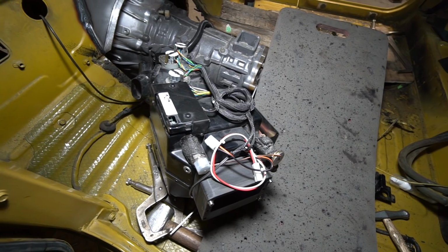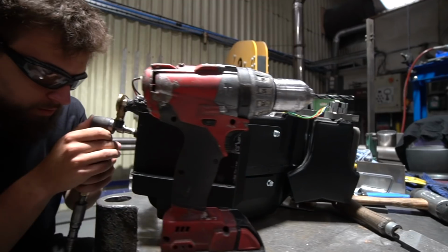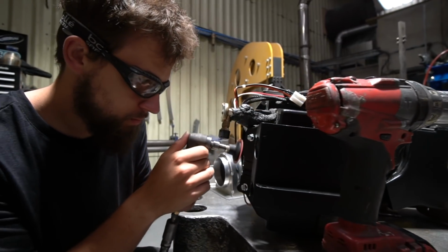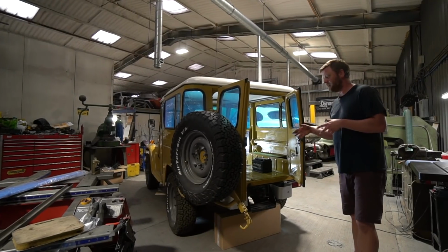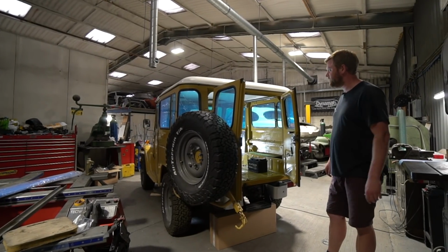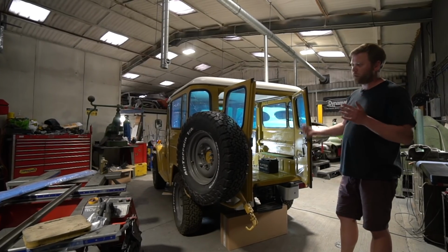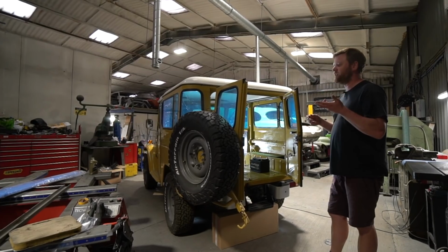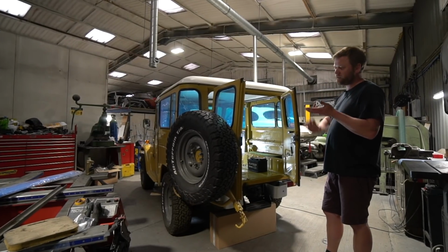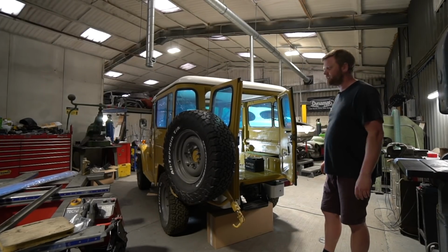The reason we want to go for one of those rather than the smaller Vintage Air systems is that the larger unit has a flapper valve that chooses between the aircon evaporator and the heater matrix, which means your change of temperature is very instant. Whereas the other ones are always blowing through both, and rely on the water valve opening and heating up the heater matrix and the evaporator gradually cooling down, or vice versa, which can create quite a delay in the temperature change.